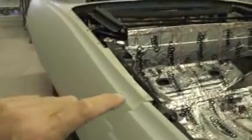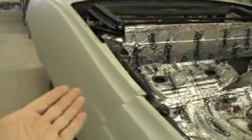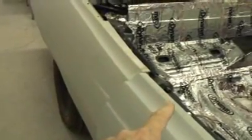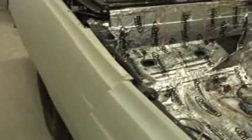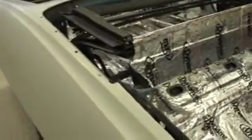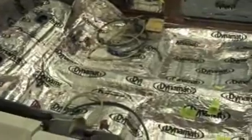When we do the outside of the quarter panels or doors, we make a template with masking paper of the shape of the quarter or door. Then we lay it face up, stick and peel with aluminum down. We take the template on top of that with the outer side on top, trace it, cut it, then custom fit that Dynamat inside the quarter with 18-inch wide pieces. Get help if you can — it helps on the quarter panels.